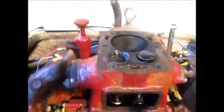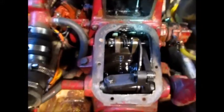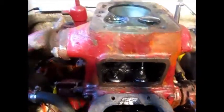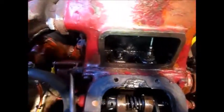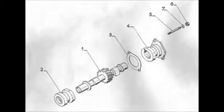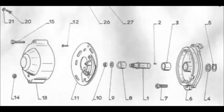What I'd like to show you is the nice configuration of all the gear equipment. As you can see, here are the outlet and inlet valve drives, and they are driven by this axle here — that's the camshaft. On the left-hand side there is the ignition, and on the right-hand side there are the water pumps.